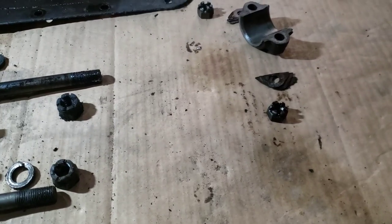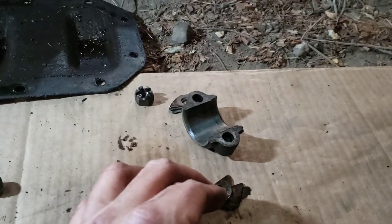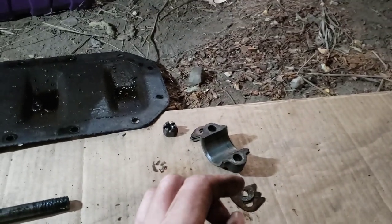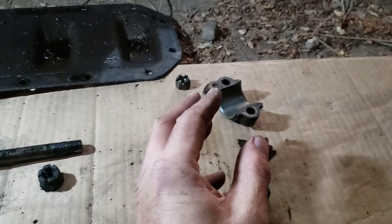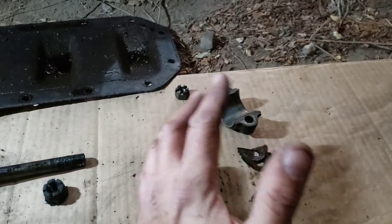I pulled two more caps. The number four connecting rod gave me a ray of hope — it has three shims on each side: a thick one, a thinner one, and a thinnest one. Lots of shims in the back. This makes sense because of the way the Model T oils: the front of the engine tends to be oil-starved. That number one connecting rod I pulled first — any time you're going uphill under load, the front of the engine is getting the least oil. The main oil driver is that big magneto flywheel spinning at the rear, so the rear always has more oil.